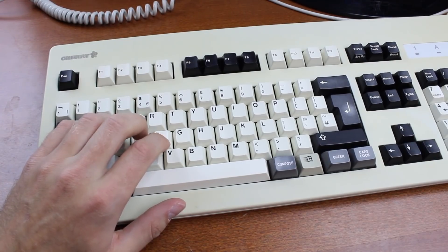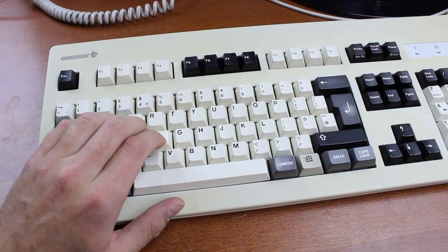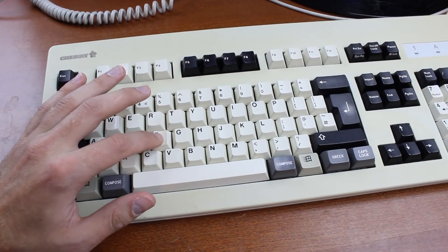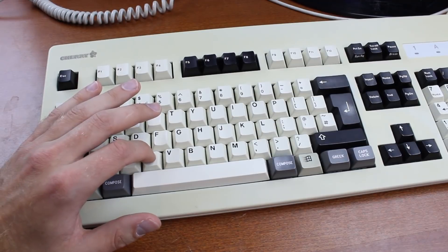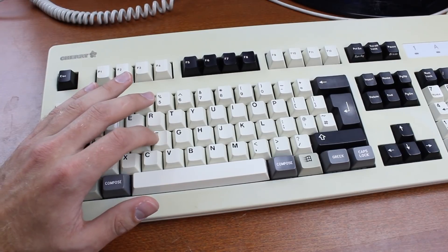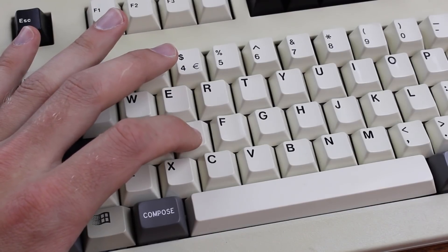Second, the feel. The first thing you'll notice is that these switches have pretty low tactility — not that MX Blue does either; it's roughly the same level of tactile magnitude, around 10 grams of force. The MX design isn't really what you should look at if you want good tactile feedback, and if you do, this probably isn't what you want either. Still, I think it feels better. Although the weighting is the same — 50 gram actuation force, 55 gram tactile force — it feels more substantial. What little tactility there is is sharper, and it feels more crisp and defined, not as loose or grainy as MX Blue. A tactile bump that is short and sharp is basically exactly what you want from a tactile mechanical switch; it's just that the magnitude is somewhat low. Kaihua measured some force curves at my behest, and as you can see from the plots, they both feature roughly equal tactile magnitude, but the dip in the box switch is noticeably sharper — and it shows. It feels nice, crisp, and smooth.